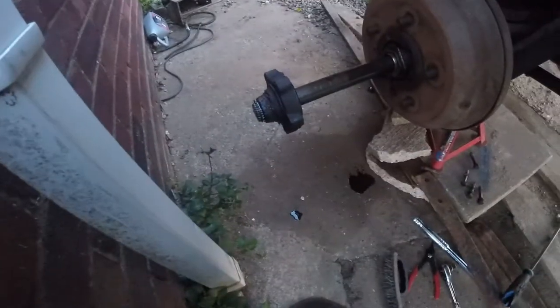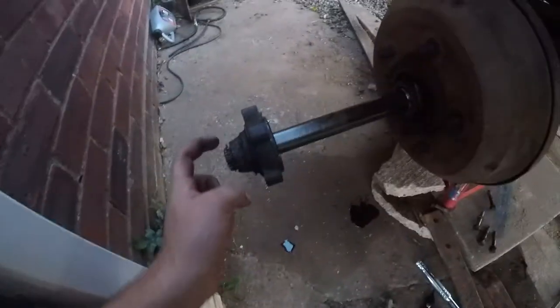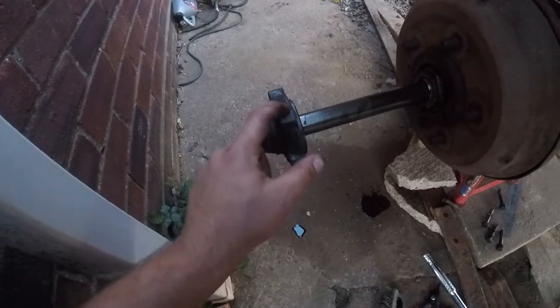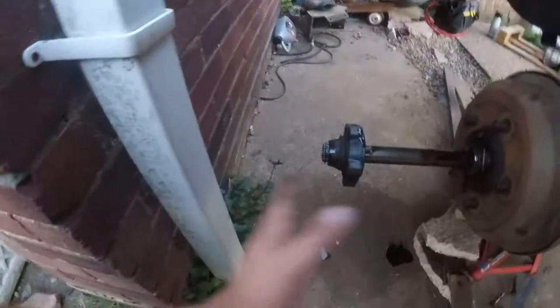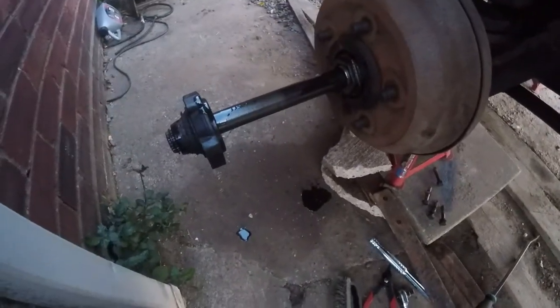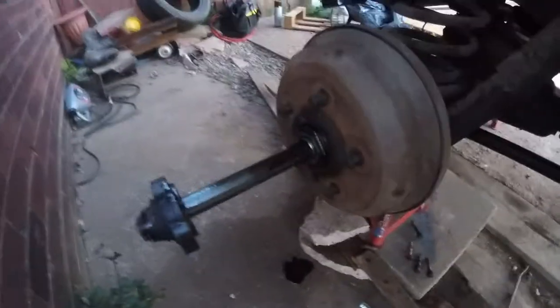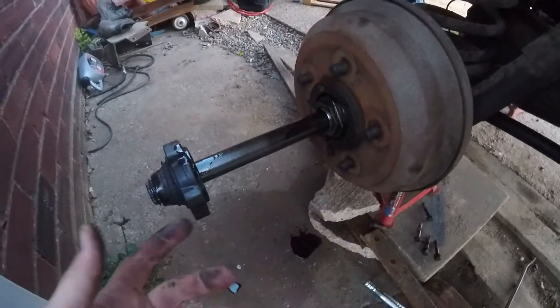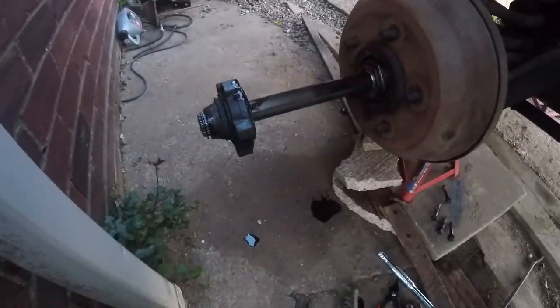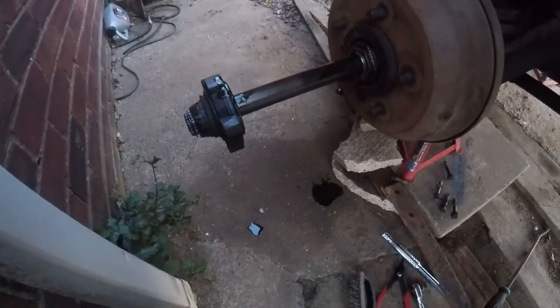As you can see, I've got the rear Salisbury drive flange off. What I'll be doing is undoing the split pin, getting the flange off, then getting the shaft out — it's obviously very tight here — and just having a little examination of the splines on the diff side. Give the whole area a nice clean up, new gasket, flange kit, this side will be done. I'm not going to bother filming the other side because it's all the same process, and this job will be complete.